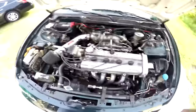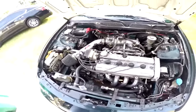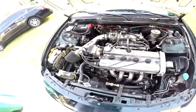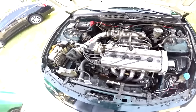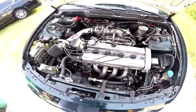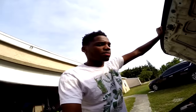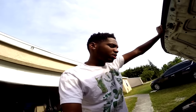So yeah man I gotta get rid of this motor. Guys, if you have a B20B and you're thinking about boosting your car, do it smart and build the block, because the sleeves in the B20Bs are trash. If you do like 12 pounds of boost on a stock block without ARP head studs, you're gonna lift the head, blow a piston, or shoot a rod out of your engine. So make sure you do it right.